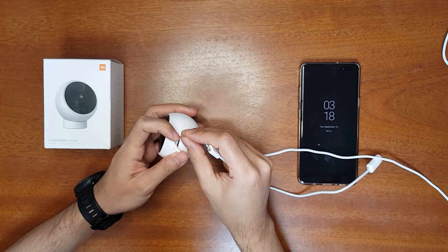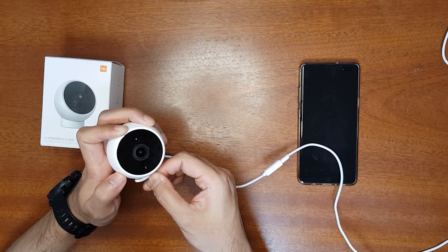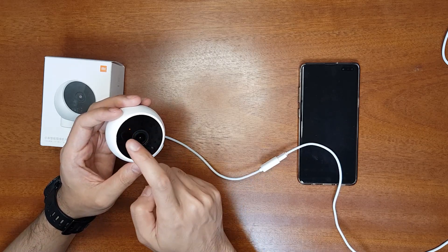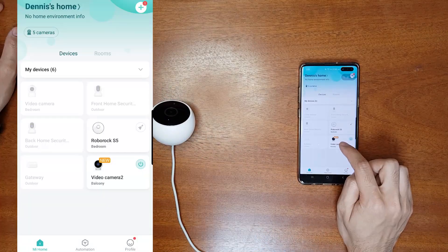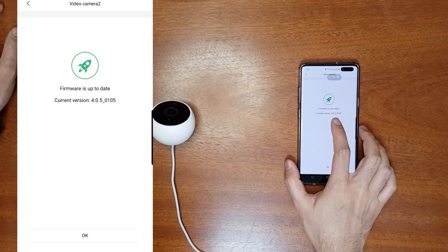Install the SD card back into your camera. Press the reset button before you power on the camera — use the SIM ejector tool. While pressing the reset button, turn on the camera and keep it pressed until the indicator light turns white. After that, it will downgrade the firmware. Wait for it to turn blue. Now it's solid blue, so we can access it from the Mi Home app.